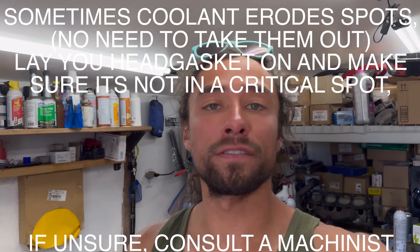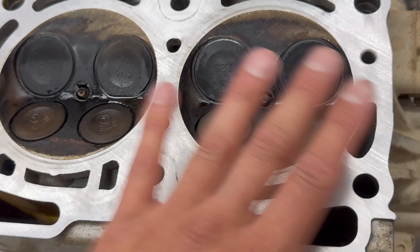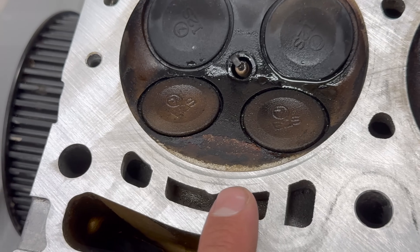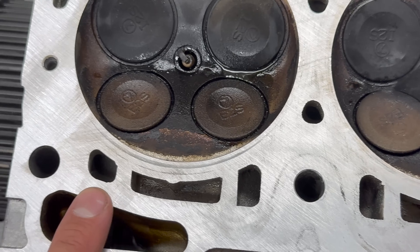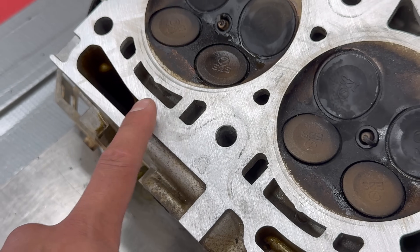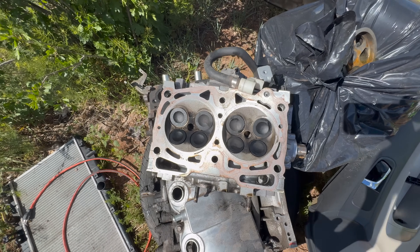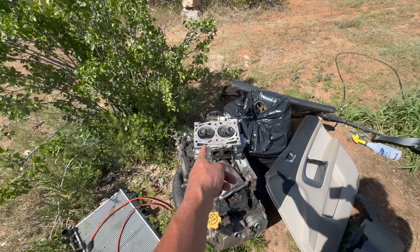I want to be 100% clear — they normally do not go that easy. It just depends on how hot you got them. Here's the second head: I just barely touched it and got the grain moving in one direction, but we can clearly see right here where it is blown, and right here too. The exhaust obviously gets hot — that's what moves first. That is the cause of our blown head gasket. 2010 and later EJs seem to run these support structures, and those ones warp less. The earlier ones are different — those jackets tend to let it move more. I remember on one I had to take 12 thousandths out of it, and that head alone took like an hour, whereas both of these are touching up in about five minutes per head.